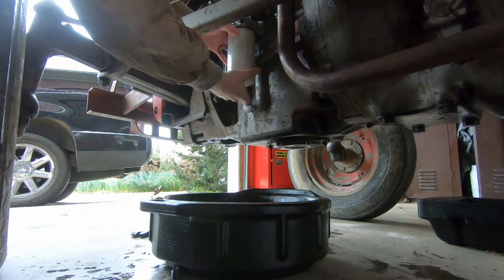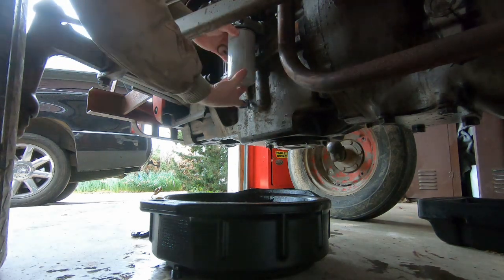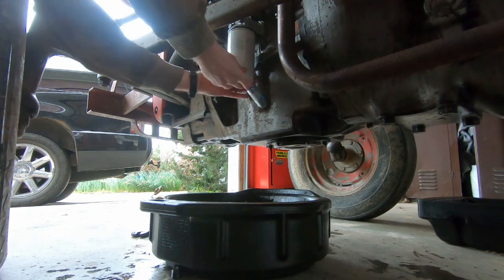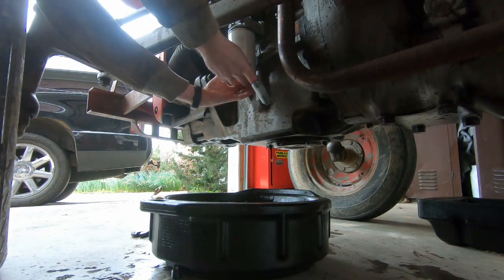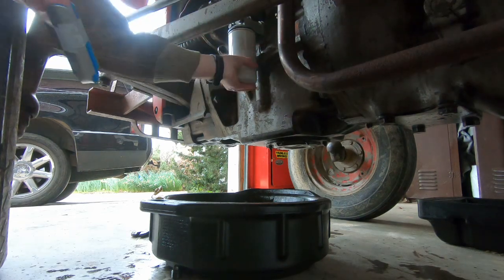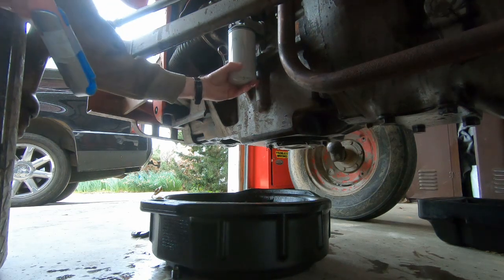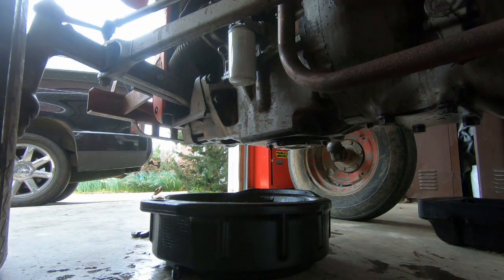You may notice that I'm putting the old oil filter back on — that's because I didn't buy the right one at the parts store, and that's okay. But if you haven't been out to the parts store yet and you do have one of these retrofit adapters, this is a Wix 51-460 filter. Had I been smart I would have looked at that before going in, but that's okay — I'll change the filter next time.